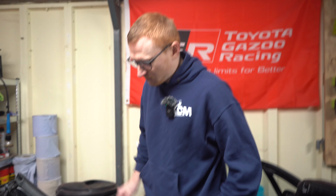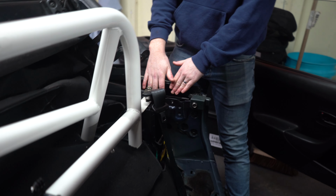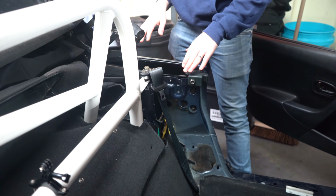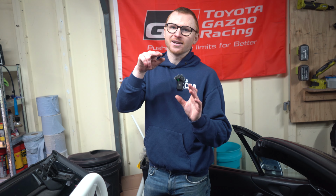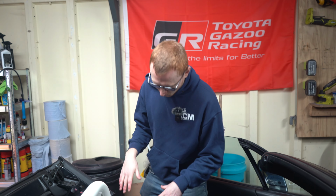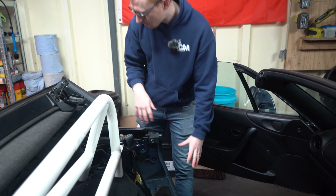Now, in my case, which was a bit wild in my opinion, the water was running into here, and then instead of going into the drain, was finding its way into the carpet. So what that was, is there was a roll of adhesive tape, which obviously had been in there a while, and the hole was obviously filling up. But then eventually the hole in the middle of the tape got clogged with all the dirt, which was causing the actual collection area to overflow into the car.